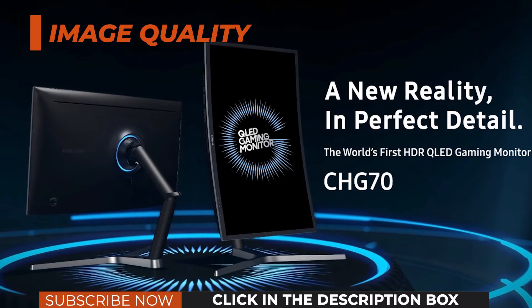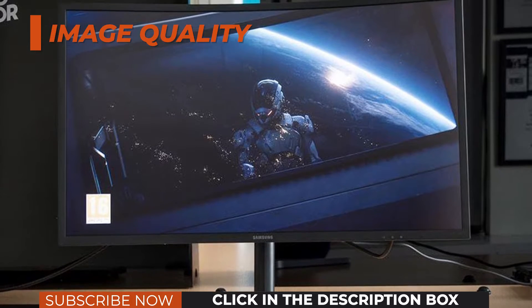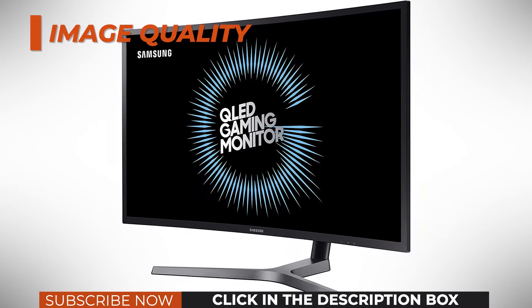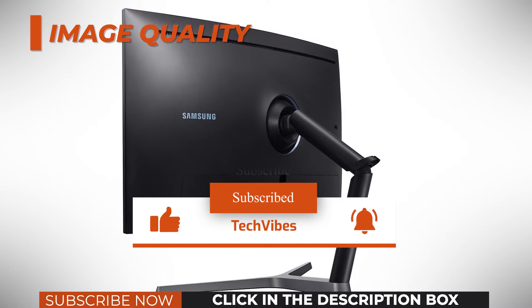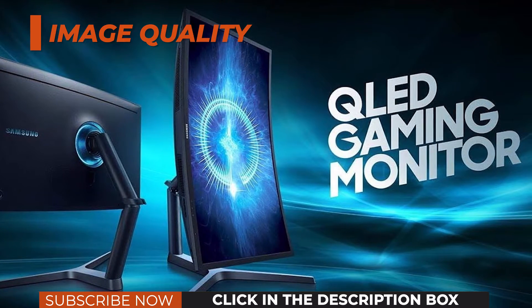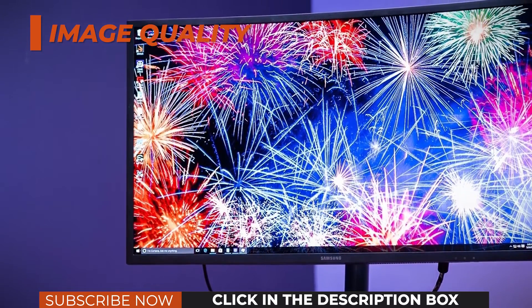Image quality. Samsung's C-HG70 series consists of the 27-inch Samsung C-27HG70 and the 32-inch Samsung C-32HG70. Both models are based on Samsung's 10-bit, 8-bit plus FRC, VA panels with quantum dot enhanced LED backlighting — QLED — that boosts the display's color gamut to 125% sRGB, 95% DCI-P3, 92% Adobe RGB, for more vibrant and saturated color reproduction. The display has wide 178-degree viewing angles and an excellent peak brightness of 350 nits which will jump up to 600 nits for HDR-compatible content.